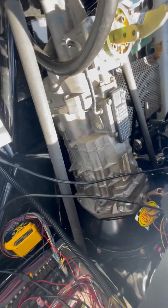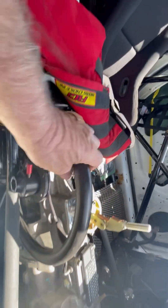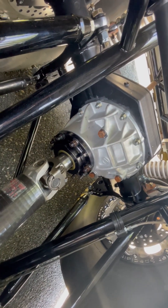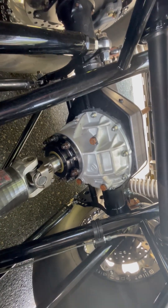This is a six-speed Tremec 60-60 Viper transmission — it's got the Viper symbol right there. We put a carbon fiber driveshaft in it. And we have a Moser Fab 9 with 40-spline axle tubes and gun drill axles.